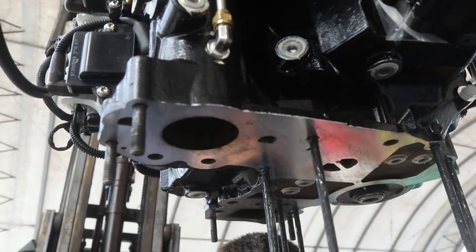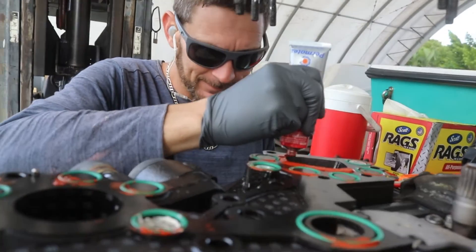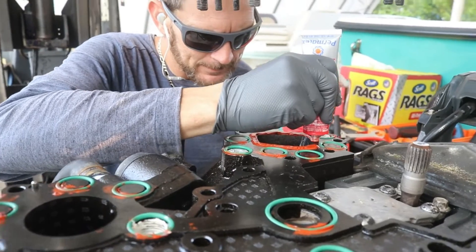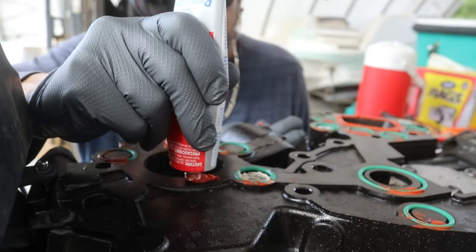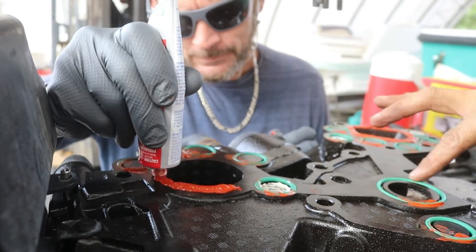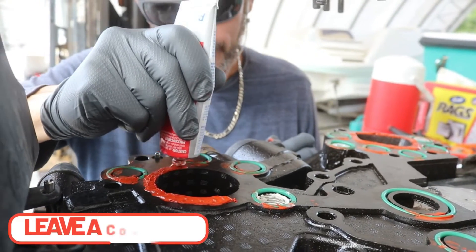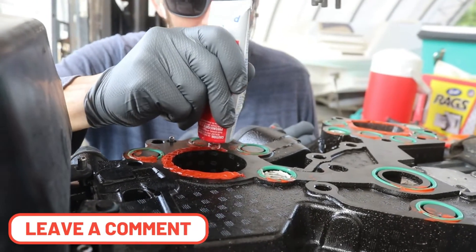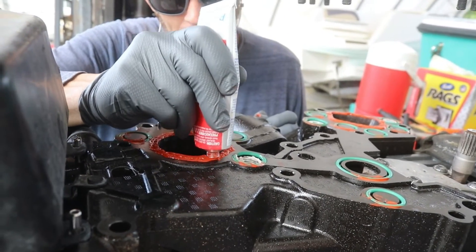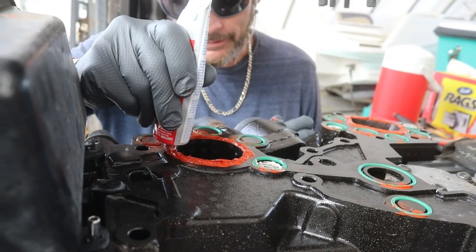For that reason the RTV over there is very important. Always use original seals, original gaskets, original rings — basically because of the material. They need to be harder than regular rubber o-rings because of the torque you have to tighten them down to; otherwise they get flat and start to leak.